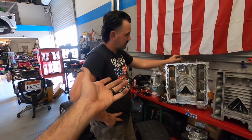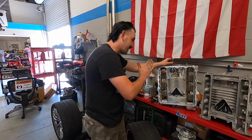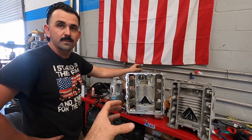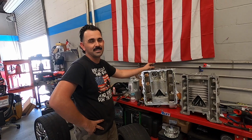We definitely have a good idea on how to optimize this setup. And one of the things that we always get is people asking us, hey, George, should I put a bigger aftermarket blower on there? That was Ben's first thing he wanted to do. We were like, dude, pump the brakes, port the blower, hit the gas, and it's gonna go fast. And once we optimize that whole package right there, this thing works absolutely fantastic. And it's beaten so many other cars that have had tons more money invested than what we do right here. Heads, cams, big blowers, and he's going 950s, and they're going like 10 slows.